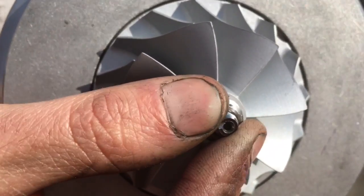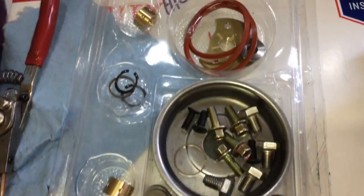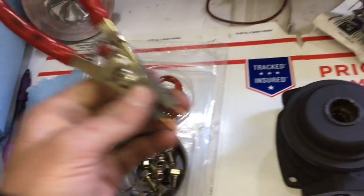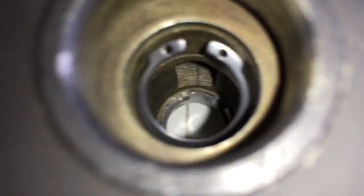This is after we completely assembled the turbo with oil in it, so yours may have a little more shaft play than what's shown here. The key to note is that the compressor wheel should nearly hit the housings but not hit the housings without oil.